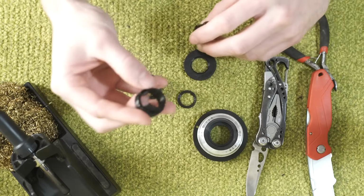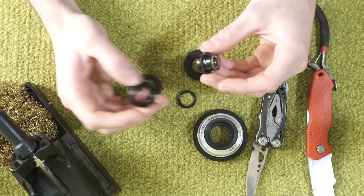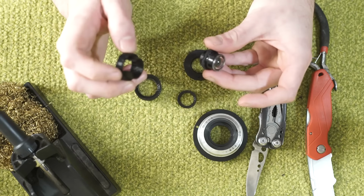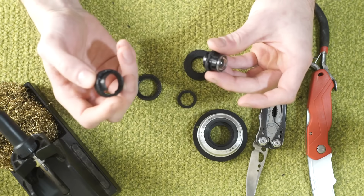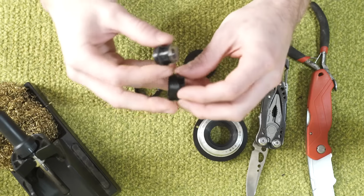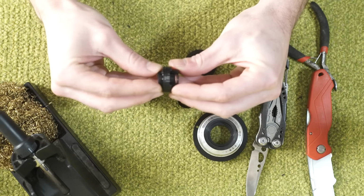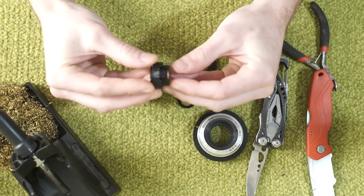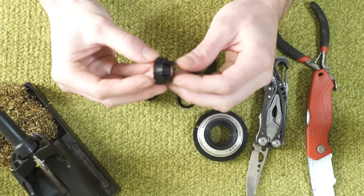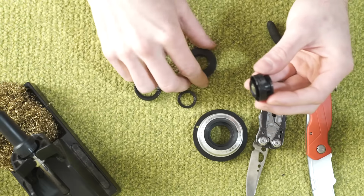We can also see some other edits that I've had to make, like this pie-shaped cutout of this section here, and that is to account for these two little knobs on this one side. And that was something that I just didn't notice when I was measuring, and so I've accounted for that in this secondary print. This simply slides in. And this clear piece of plastic aligns with the back of this black piece here. That's how we know our alignment is good.